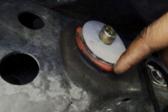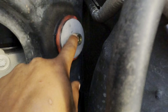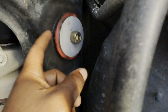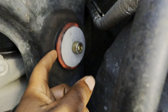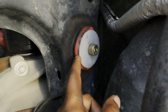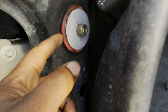What I'm probably going to do off camera is check this bolt because it runs all the way through back here. It'll be a challenge trying to film that and get the bolt out so I can check the poly bushing. This is not an insert that you just put in on top of your regular stock bushing — all the stock bushing was cut out and I put these in. I didn't go with the solid ones due to the noise, but if it is a problem with these, I'll probably have to pull the diff out and put new ones in.